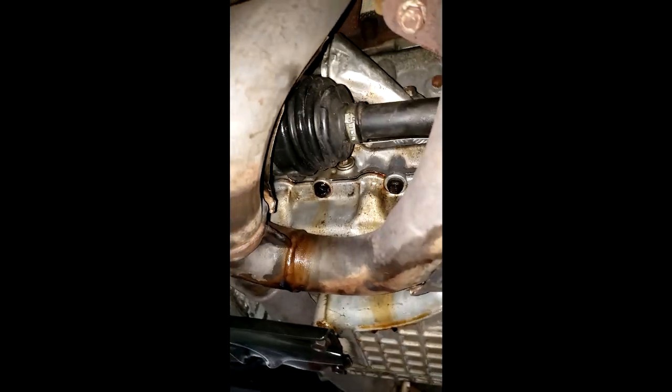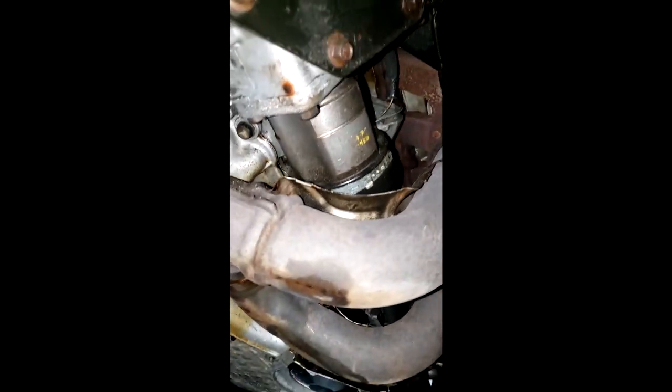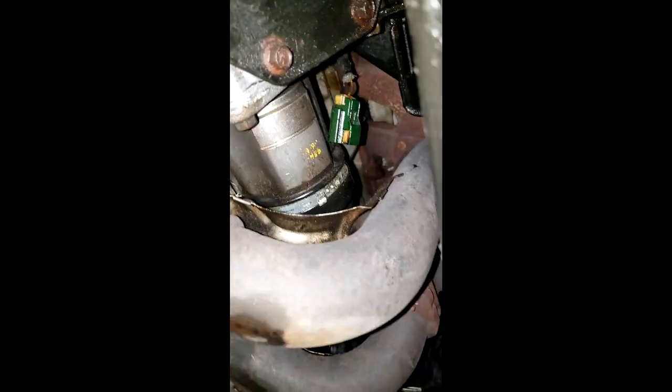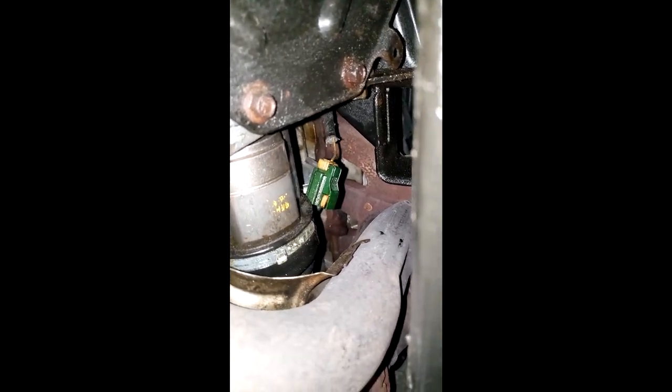Check this out — so-called recheck. Yes, there is an oil leak. It looks like this oil leak is coming from that sending unit. The oil sending unit is right above it. You can see the connector right there. I know I pulled that little tab out — I pulled that out on every one I do. So can you imagine what would happen if that tab was still in there and that oil pressure is being pushed out? There's a chance all that oil can go through that one wire and migrate up through that wire into the computer.